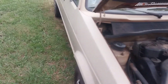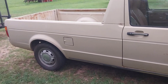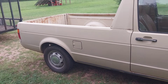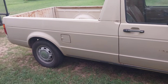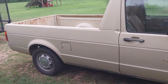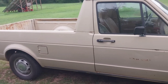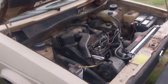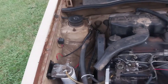The biggest problem I had is my fuel tank. When I was getting this thing back on the road, I had the fuel tank down, looked inside, and it was all rusted. A new one is $350, and I could get a guy in town to clean this one for $100. In hindsight, I should have gone with the $350 option because he didn't get it all cleaned out, and there were just flakes of rust all over the inside. As you're driving along, the fuel sloshes around, loosening the rust — it ends up in the fuel lines, the fuel filter gets clogged, the engine pulls a vacuum, gets air in it, and it just doesn't run.